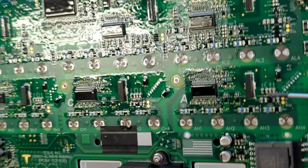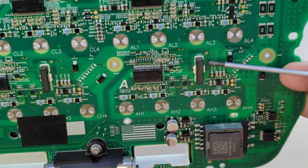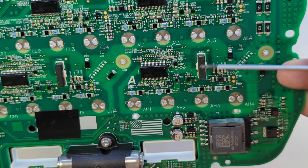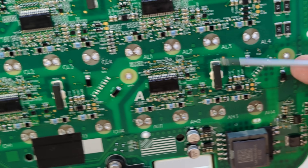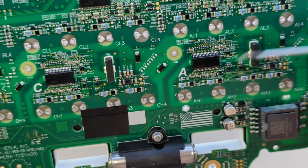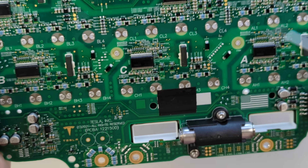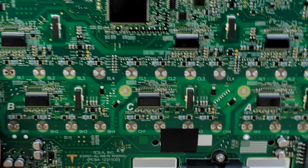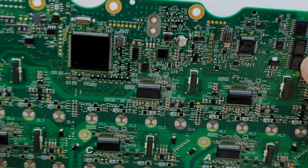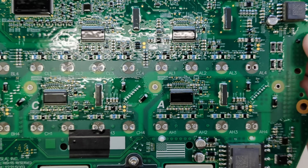We've got these little planar transformers here. The turns of the transformer are layers of the PCB, and then they have this ferrite that goes through the board — it's a cheap way to do a transformer. This is probably for isolated power for this circuit so that each section can have its own isolated gate drive, because you see one per section. We've got sections A, B, and C — these are the high side and these are the low side, so one for each of those. We've also got some isolation chips here, probably digital isolators — I'll put the part numbers in the description. And a bunch of test points and things like that.